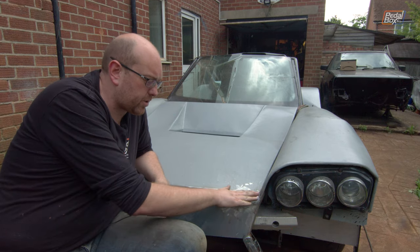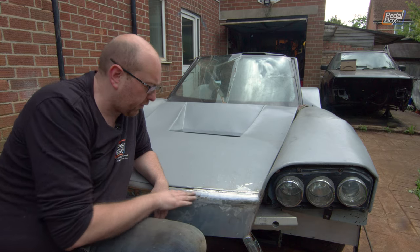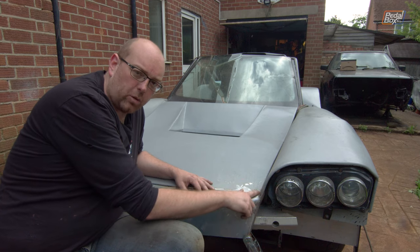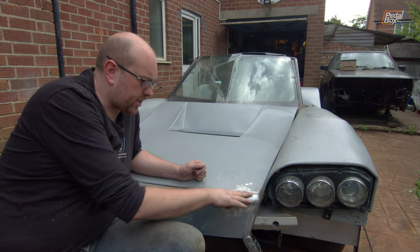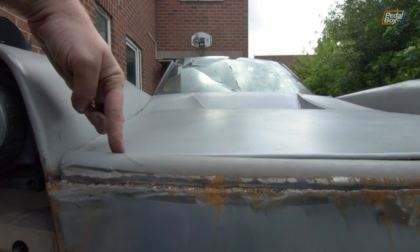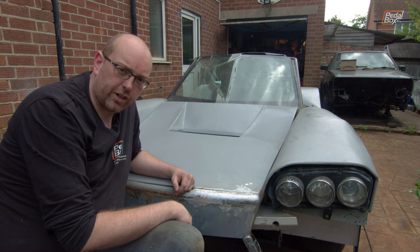After an hour or so, we've managed to get this reasonably smooth, and the transition from the front plate here up and round into the bonnet is almost perfectly what I was looking for. The gap along the back is also nice and even now, and the bonnet still opens up. This corner is a little bit difficult to get past, so that might need some very fine tuning in the future, but for now this is absolutely fine. I've built up quite a lot of this back edge with weld, and we can see how the bonnet had a step from the front which went up to get onto the top, and at the edge it dropped down behind this little roundover piece that we've now fixed on this side.